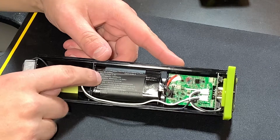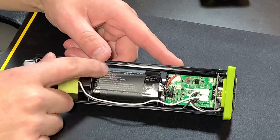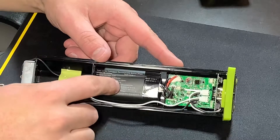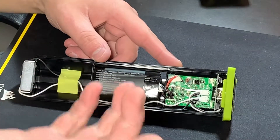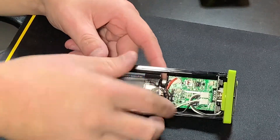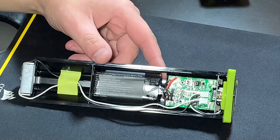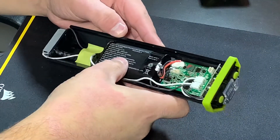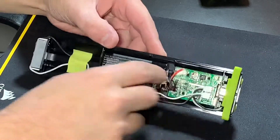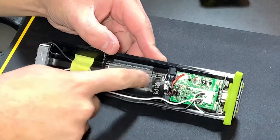Right here is the battery. It looks like two 18650s wrapped inside a commercial pouch battery. It's soldered on, so you can't unplug it. If you want to replace the batteries, you'd just have to unsolder them and put in a couple of new 18650s. They're in parallel, so they make 3.6 volts, and it looks like they have their own protection board under there.